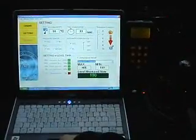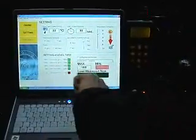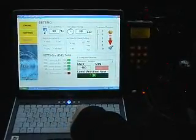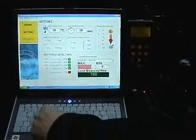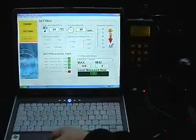For this particular switch, it's an OMB switch, and by using a magnet and going from empty to 80%, we've previously worked out that the correct zero figure is 0, and the correct maximum figure for this gauge is 450. Press enter, locks it in.